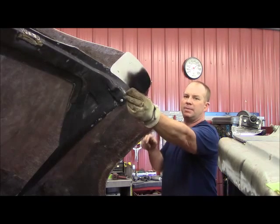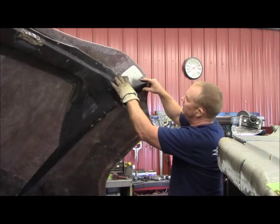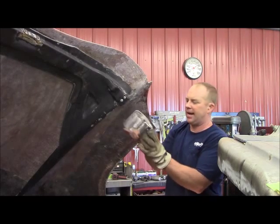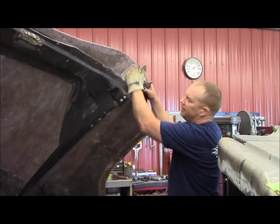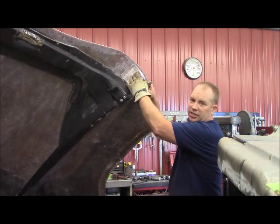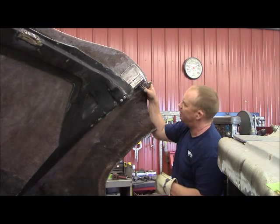On this side, I used the template I made my sheet metal from over there and just brought it over here and did a little doctoring on it — it's a little bit different since the fiberglass varies a little from side to side. I laid that on a piece of flat metal, trimmed it out, and hammer formed it to make it match. Once I got that made, I made my little piece of angle to hold it and now I've got my strike on here. I'll put countersunk rivets into the fiberglass and lay fiberglass woven mat over top of them so you don't see them. Then I'll bond adhesive to this panel — the bonding adhesive alone would probably be enough, but I don't want to take any chances, so I'll rivet and bond it as well.